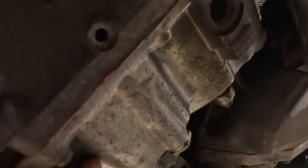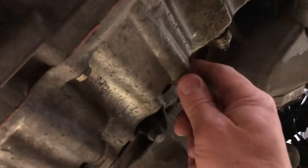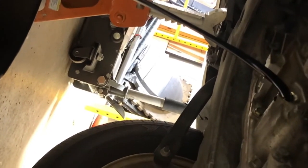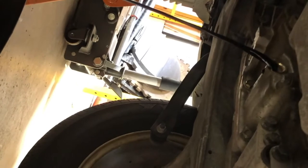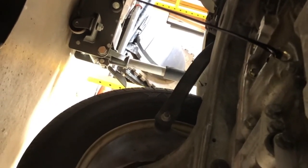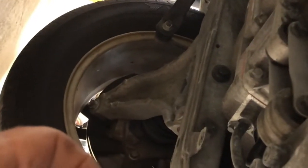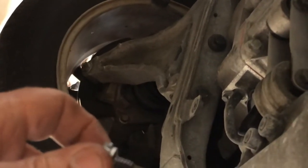My point of attack is right here — this is the transmission that I'm going to drain and fill. I'll pop this plug loose and drop it into a pan. I popped the plug with a 24mm — it seemed a little loose; 22 was too small. It cracked open and I got the plug out. As you could tell, that transmission fluid was pretty burnt.